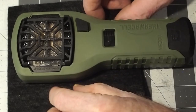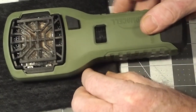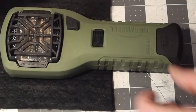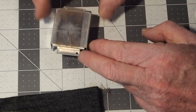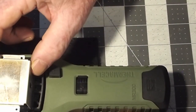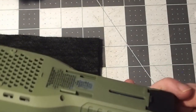In conclusion, if you've already got one of the hand warmer kits and you have some catalyst left over, there probably isn't any reason not to give it a shot. You just need to remove the six screws on the back and the two screws holding this piece in. Once it's out, you can set it aside for next summer, and it's easy enough to put it back into the Thermacell and restore it to its original intent for repelling mosquitoes. It's not a destructive mod — you can use this device year-round.